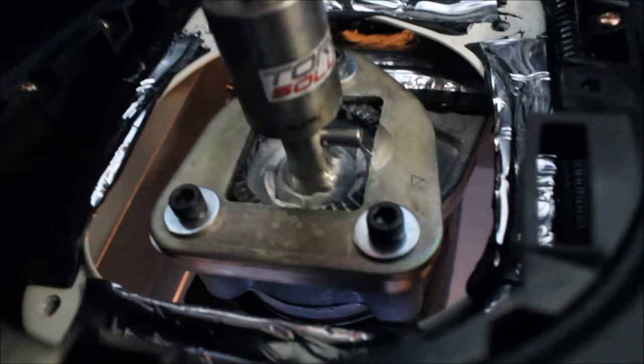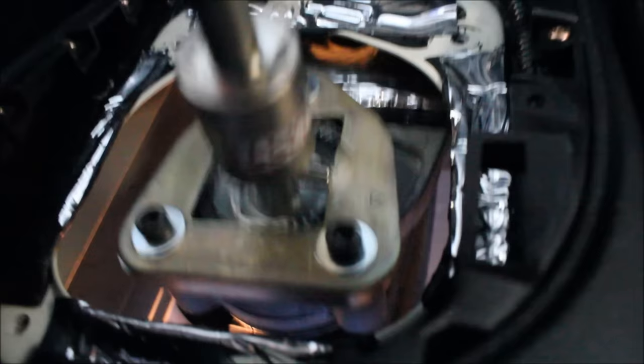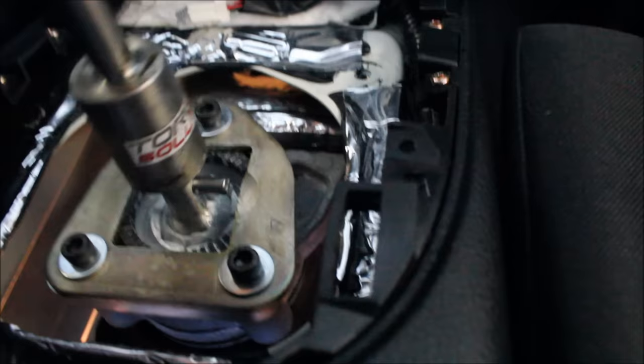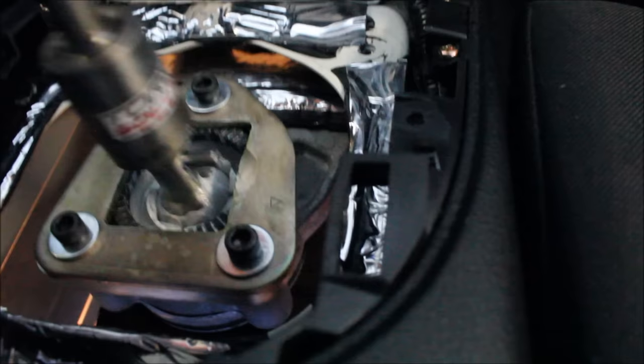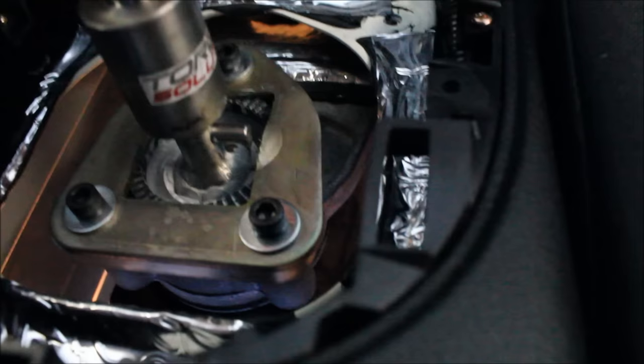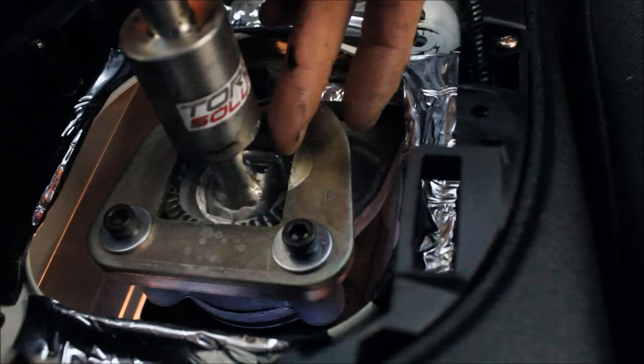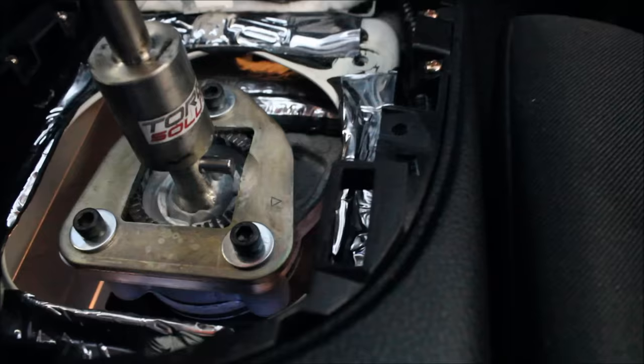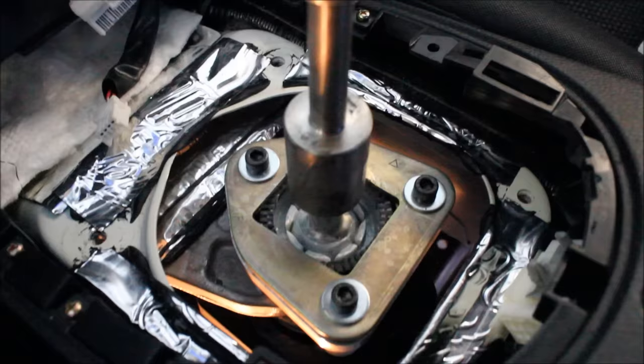This thing feels like a bolt action rifle right now — it feels better than a stock S2000 shifter. The main thing you want to watch out for is where a lot of aftermarket shifters fail: this notch, the reverse lockout. Here's fourth, fifth, sixth — and right at first you want to make sure you go all the way down and into reverse. At first it didn't go in right away so I had to put it into gear a few times, and it kind of worked out some of its own material. Now it's sliding in nicely because this has a slightly different shape than the stock one — the stock has a small chamfer on it so it goes in easy. Make sure you test that it's going down and in and you can get that reverse.